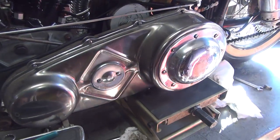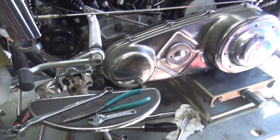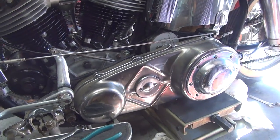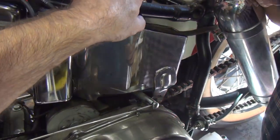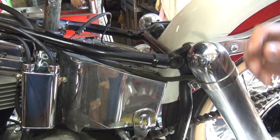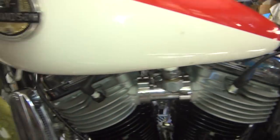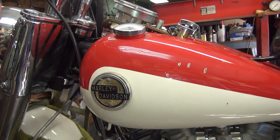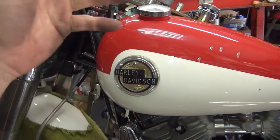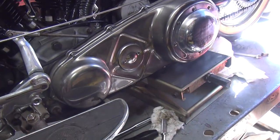The wire's too short - it's about eight inches too short to do it all that way. But it just needs to be made to work - like everything. I was able to stretch the brake switch wire, but it was really, really tight. We had to really pull it pretty good to do it. All of the other stuff is still functional the way it is, but it has to be hooked up however you had it before on the battery stuff. It should be pretty straightforward on that. And then all the handlebar stuff is going to have to be run to your dash where it needs to go.